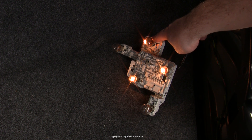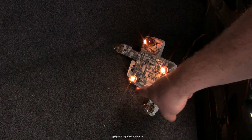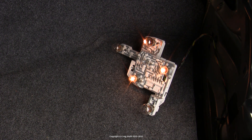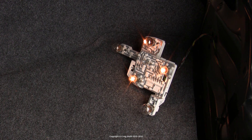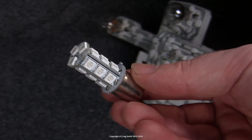The outside one of these bulbs doubles as the brake light and it has two filaments in it with a dual-mode behavior, so we're going to ignore that one in this video because it's a little bit more complicated to find a suitable LED to replace it. We're just going to replace the other two bulbs, which are both five watt conventional filament types with a BA15S socket.